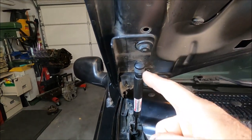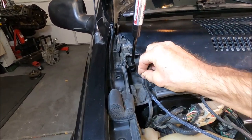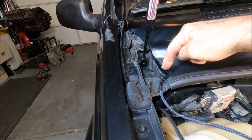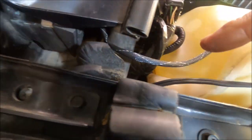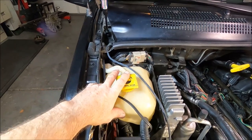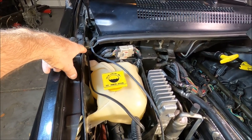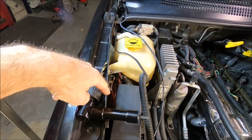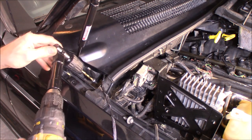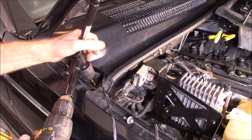I've been working on a wire tuck, and that's why I'm going to such great lengths to hide all these wires — I don't even want that little bit of a loop to be seen. What I'm going to do is drill a hole right down in here, which will bring me into the engine compartment right behind the ECM. To make this whole thing a little easier, I'm going to remove this reservoir — just two 10mm bolts — so I can get down in here and dress that wire into the existing harness. I'm using this angled drill attachment; these are relatively inexpensive, I'll put a link in the description. It makes it easy to get in here because the drill would hit the hood otherwise, and I don't have to remove the hood this way.